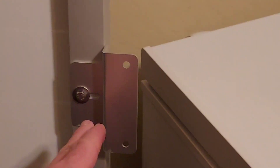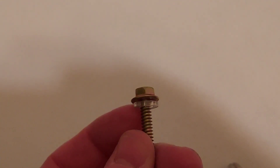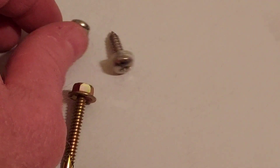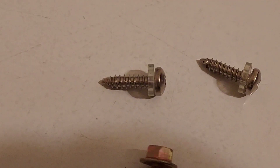I went ahead and bought these Renogy brackets to mount onto my Renogy solar panels and mounted those on there. They come with these really long — looks like inch and a quarter — screws with a rubber seal washer, which I like, but I'm not going to put those in the roof. The roof is only 3/8" plywood, so I'm going to use these 3/4" long wood screws and put that rubber seal washer on there. I'm showing this now because when I install it I won't be able to show that, but that should work out fine.